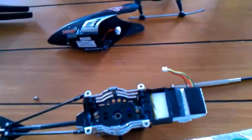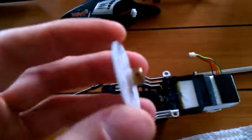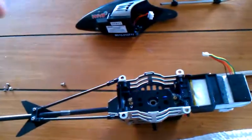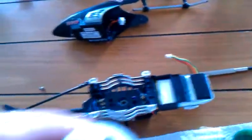At the bottom of one of the gears is a little brass collar. Remove one screw, pop that gear off, and the whole unit slides out. You can then slide the broken gear off.